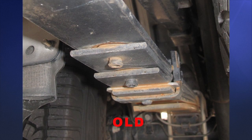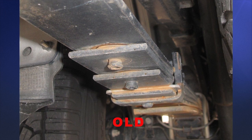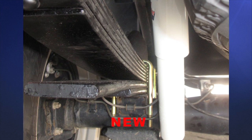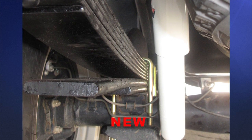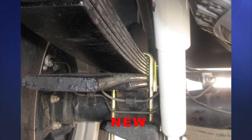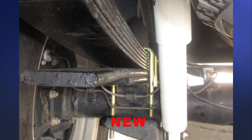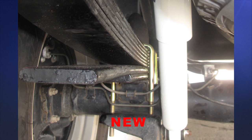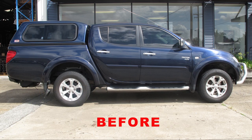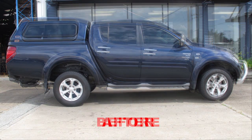So let's just have a look at how these rear springs were before — tired, flat and sitting down on the second stage. And now, with good camber in the primary spring giving us height and a gradual introduction of all leaves in the spring, and the second stage well away but still ready for when the big loads come on and the primary flattens onto it gradually. Point of interest: the second stage starts to work on every part of it that is in contact with the primary spring above, not just when the primary lays right down on it with the ends touching. And here is the before and after comparison — improved height and clearance, able to carry a load better and a guaranteed better ride.